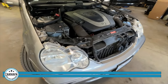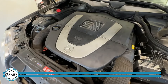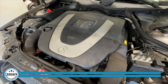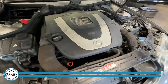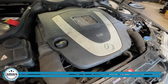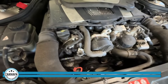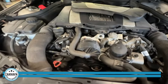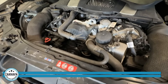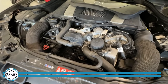So here she is — it's an '07 C280, M272 V6 non-turbocharged engine, made when engineers ruled Mercedes-Benz, not the MBAs, so the decisions were made on the basis of good sound engineering. They put this engine in a lot of different things: C-class, some E-classes, SUVs, a whole range. The issues we see sometimes are not in the timing chain per se — those are also pretty solid — but in the camshaft solenoid. Those components come towards the front of the camshaft.